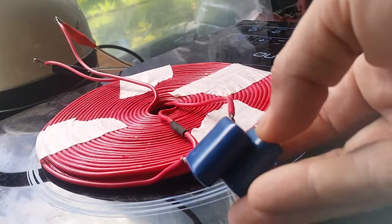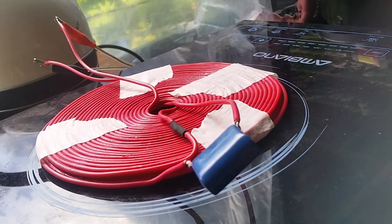I was thinking maybe tune it to quarter wave, like a Tesla setup. But I just wanted to cover the cooker mods, so that's it — crush the beeper, put 100k ohms across your thermistor, and you've got the thermal cutout to deal with.